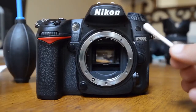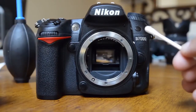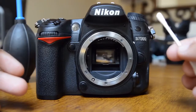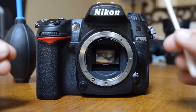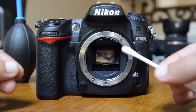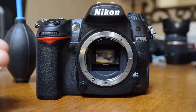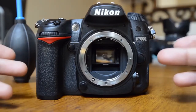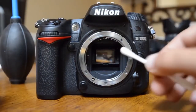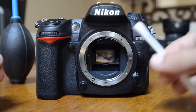Please don't do this with your image sensor — don't touch the sensor with anything. I know there are tutorials out there using brushes to dust off the actual image sensor, but I would not do that. You spend a lot of money on this equipment, don't take a chance. There's sometimes oil on your sensor as well, and there's a wet kit people use — I personally would not take that chance. Get in touch with a professional from Canon, Sony, or whatever camera you're using and have them clean it. In most cases, the rocket blower will do the trick.